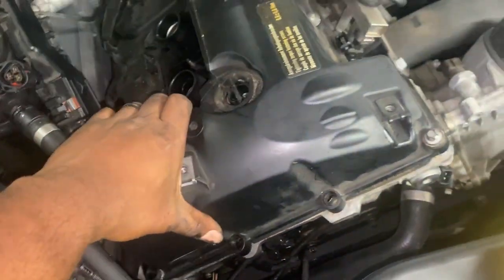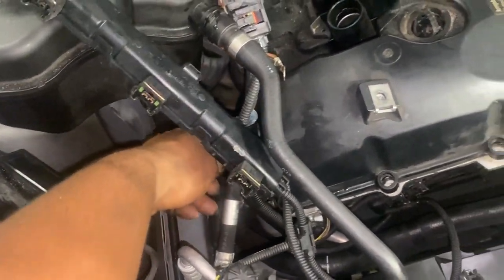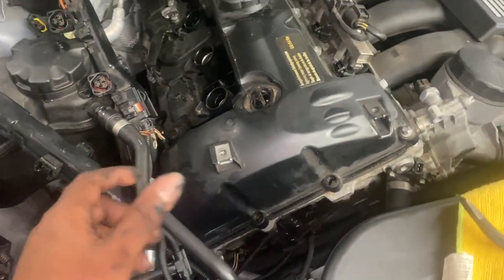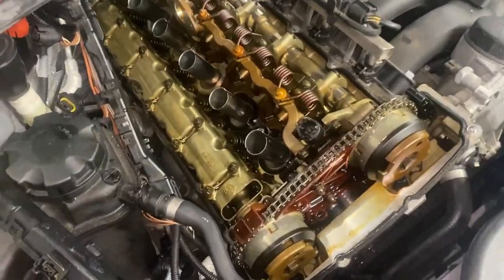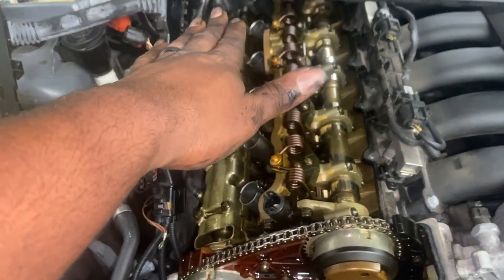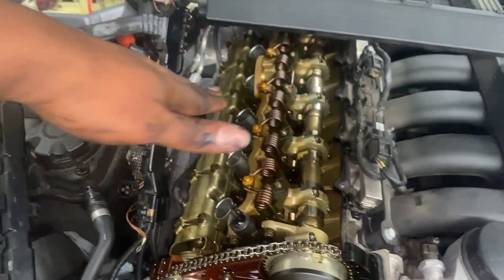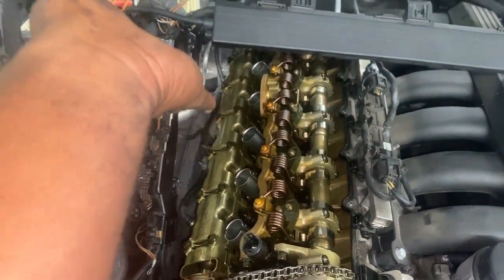Normally they'll pull up by themselves but in this case it's heavily sealed, so I had to pry it up a bit. The spot where I was able to get something between it was right here and back here at the tip. There's a little indentation where you can put something in between to lift it up. I wrapped the tool in a rag so I don't scratch up the block and gently pried up on the edge and at the back of the valve cover. Please make sure all bolts are fully loose before you pull it up — I had one issue where a bolt was loosened but not fully out and it kept it from coming off. Double and triple check. It's off now — this side came up first, then you lift the rear, so it's at a downward slope. Lift the front first, then the back, and ease it out.